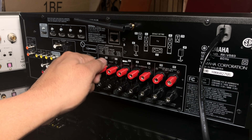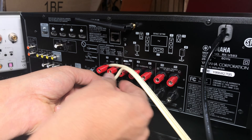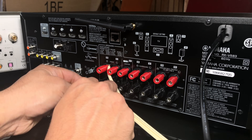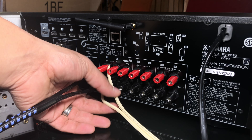Let's move over to the Yamaha RX-V583 — I'll put a link in the description and in a card. If you have a receiver where you can't use spade connectors, I would recommend using a bare wire connection first. When you're done connecting the bare wire, tighten the binding posts as much as possible, and then we're going to use banana plugs for the second cable going to the other frequency binding post. So there you have it — that's how you bi-wire your speakers from your amp or AV receiver: one output going into two separate binding posts on the back of your speakers.